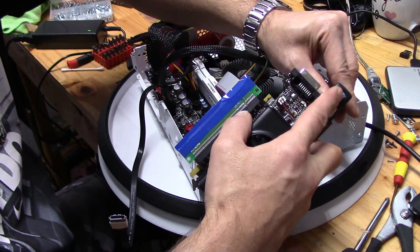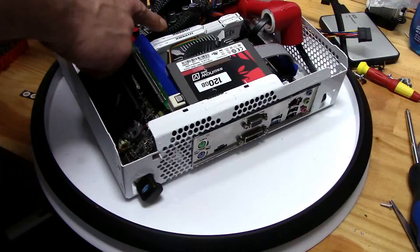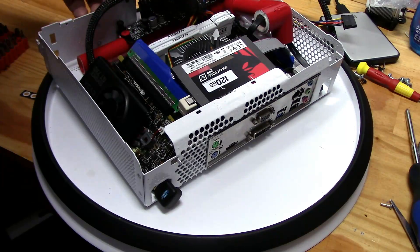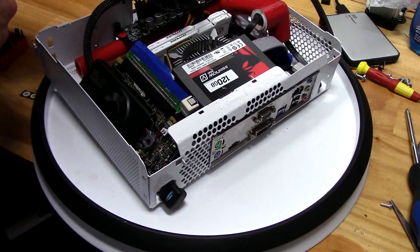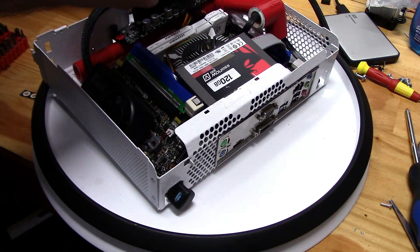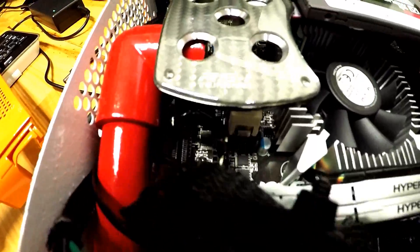I'd love to say this project went together smoothly, but it just didn't. You're going to run into problems when you're doing something just out of your head. Think ahead about where components can and can't go. The graphics card didn't end up where I planned, I didn't plan on using that long cable, I had to take out the PVC the Pico power supply was mounted to, and I actually grounded it out when I put everything back together — so I ended up double-sided taping it. I also had to remap the power button because it just wouldn't work. I just hope you get the general idea of how this was done, and if you plan on doing something like this, keep a couple steps ahead.